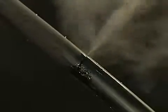Incorporated into the smoke machine oil is a dye that is visible using an ultraviolet light and yellow glasses. This dye is visible where the smoke leaks from the evap system. The dye will be seen as a blue-green residue in the area of the leak. This leak detection method is good for finding very small leaks.